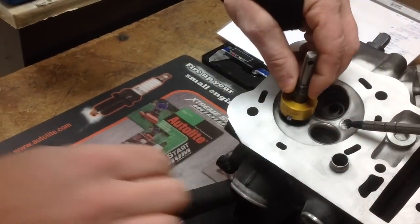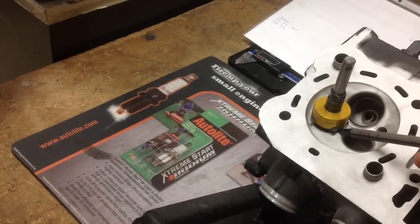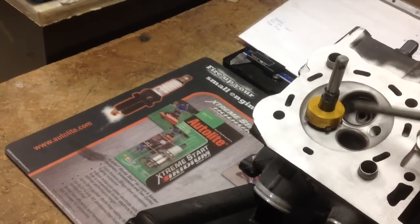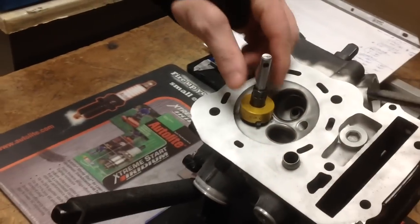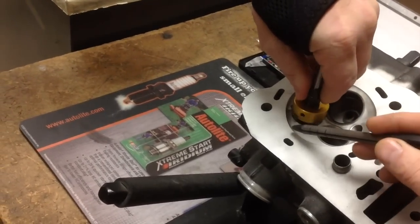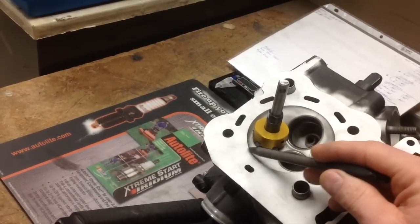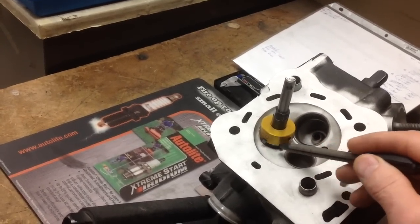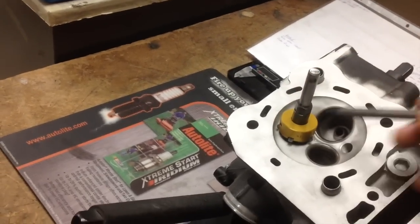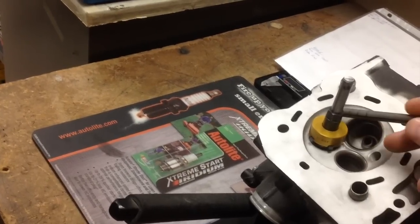Do not drop it. These carbide blades are so sharp that if you drop it down that pilot, it will leave dents in there, and then you'll feel a skipping sensation as you turn the cutter head. Will you just spin that with your fingers? This combustion area of this particular head is pretty round. Some modern motorcycles have a combustion area that is not round, and the valve will actually be in a pocket, which means you have to watch the tips of the cutter head as it comes around because it may come into contact with that pocket. So after setting up the blades, it's always a good idea to turn that with your fingers to make sure it's not coming into contact with any of the aluminum portion of the head.